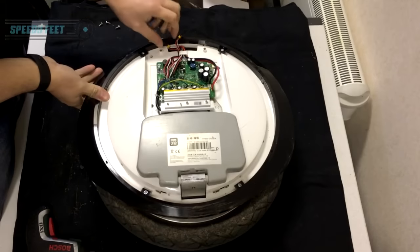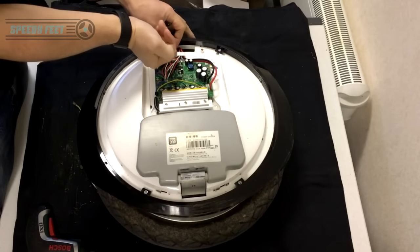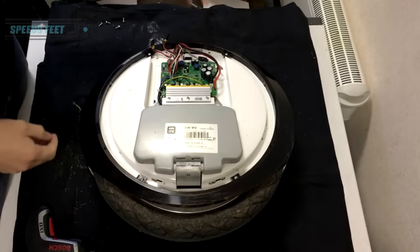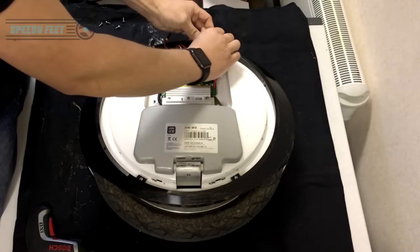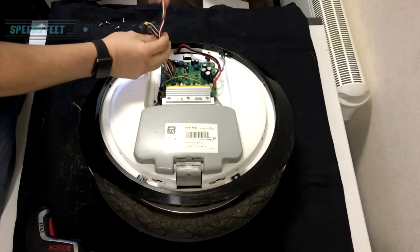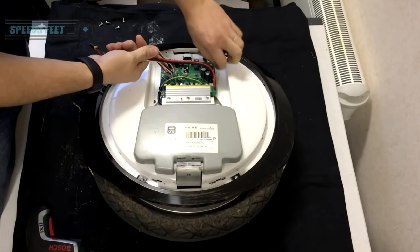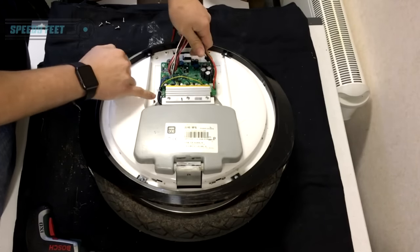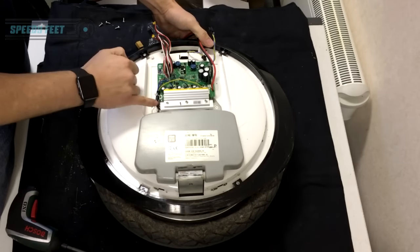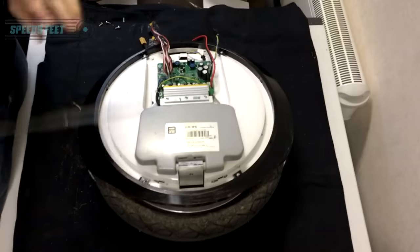You've got the cables laid out, and the light ring cables are underneath this clip here. It's just a case of pulling this up and slowly removing these cables out — so they're now free. Disconnect this cable. Now all the cables are free, and you should be able to pull those through, and pull the battery one through too. That leaves basically nothing attached at all, apart from the motor cable and the board itself pinned down by the screws.